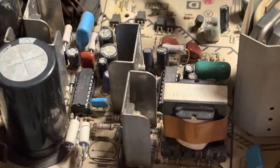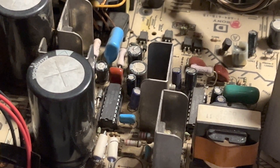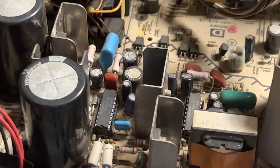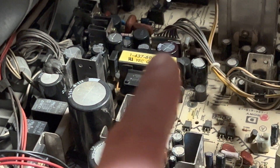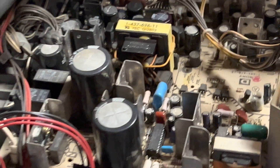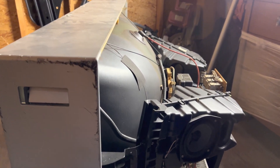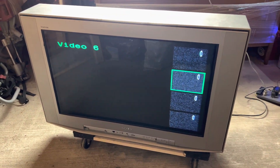You can see those are the image chips you want to replace. I ended up putting in these sockets — that way it's just easier if it comes time to replace them again. And there, that guy is your capacitor that was going bad. So hopefully this helps someone out. Obviously be careful in the back of a TV when it's on. I'm no safety professional, but I got it back working.